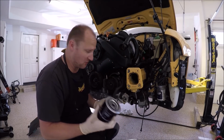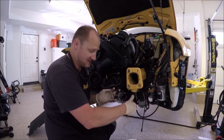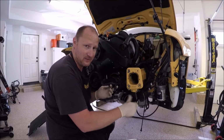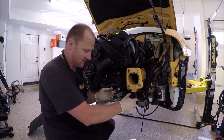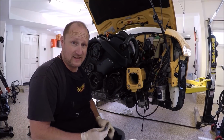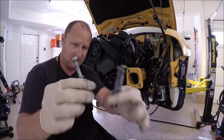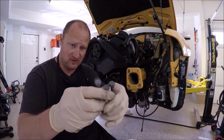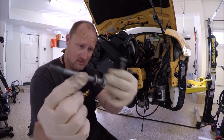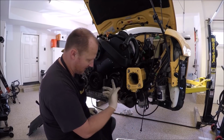I'm gonna go ahead and put the oil filter back on just loosely. I will be replacing this when I add oil to the car. I just keep it on there right now to keep oil from dripping everywhere. And it just has to go on kind of hand tight, not very tight. Hopefully you guys bagged and labeled your nuts and bolts. If you didn't, it takes 3 13mm bolts, and this is what they look like. 2 up front and then 1 from behind and up.